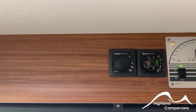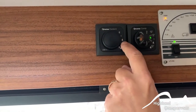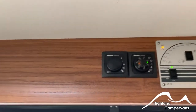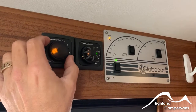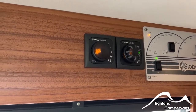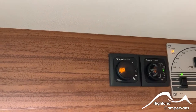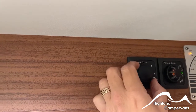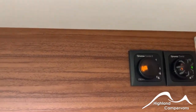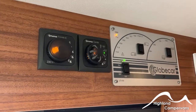We see the amber light come back on again indicating that the water temperature hasn't been achieved yet. Whilst we've been talking and setting this up, this nodule here has been pointing towards the gas, so we've been burning pure gas in order to generate heat and water heating. If you were on a mains hookup, you have the option of using a 900 or 1800 watt mains electric element, subject to the amperage available — roughly around three and six amps draw from the circuit. In wintertime you could use a combination of the gas and the low or higher setting on the electric; it doesn't increase the heat or water temperature, it just simply speeds up the process and gets the water warmer more efficiently.